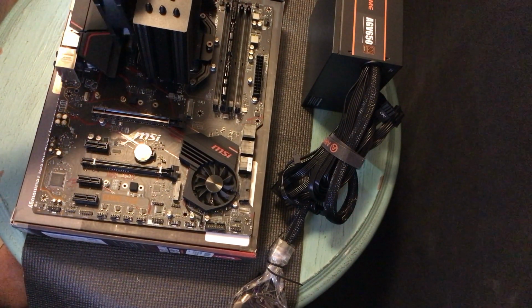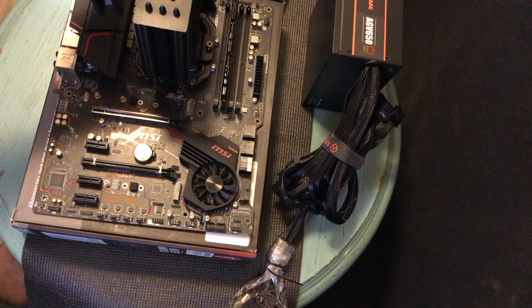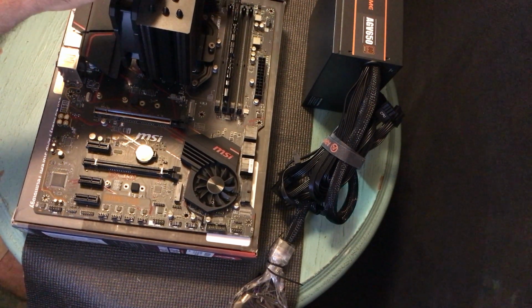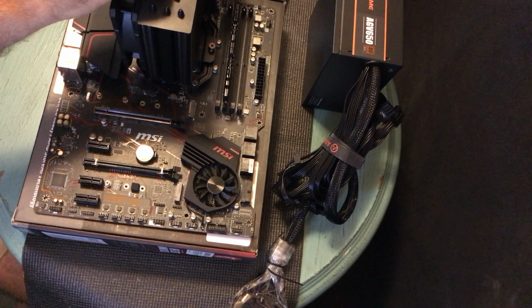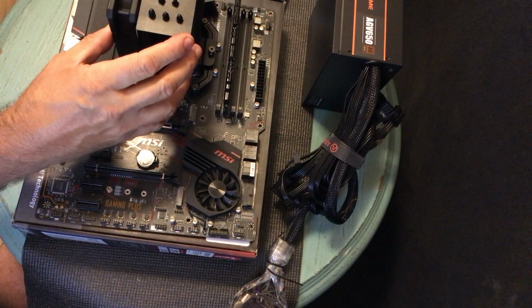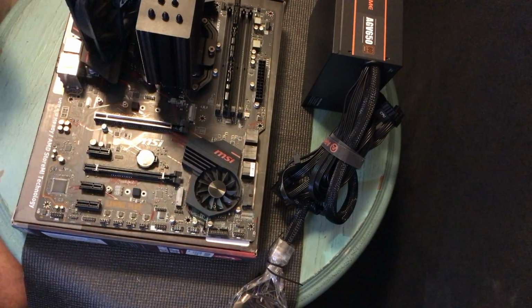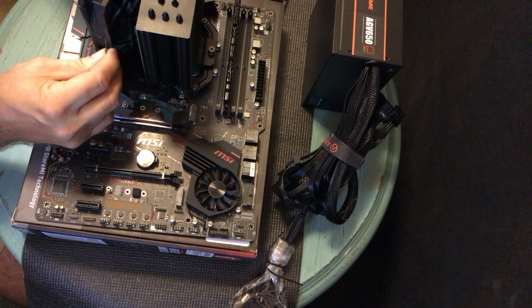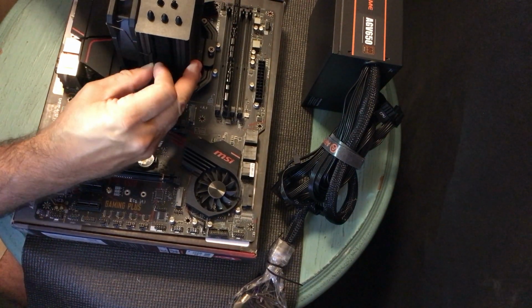See, again, it's just a board. And what I do, I will put a very old GTX 760 GPU on slot 1 PCIe. Why do I do that? I do that to get the display up so I can get into the BIOS and set it. Without that, I can't do a damn thing. I need to have a GPU on here the first time to configure the BIOS to run headless.